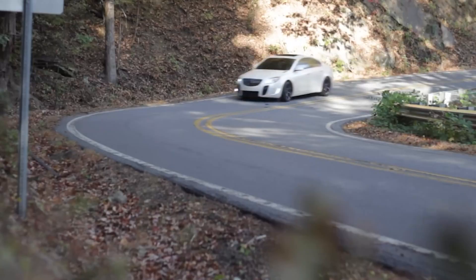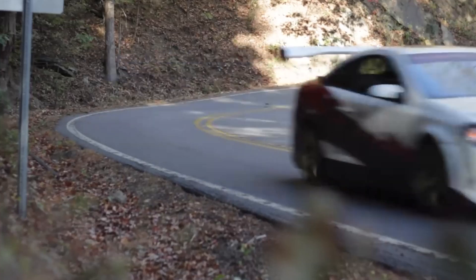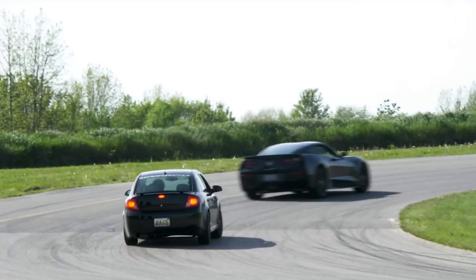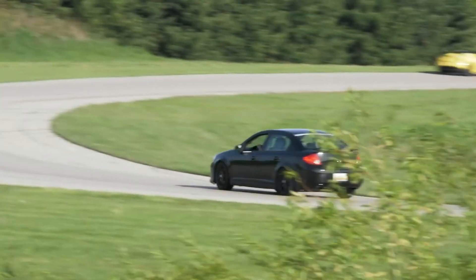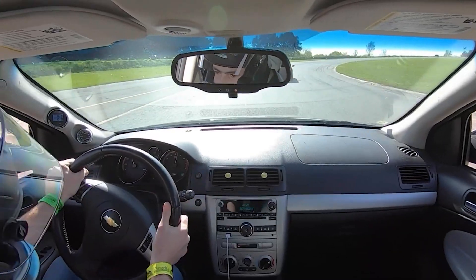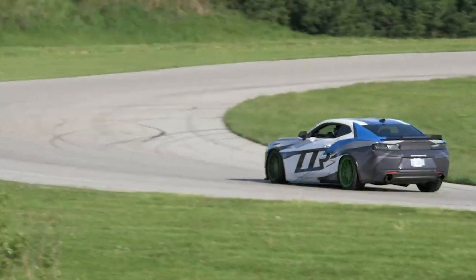The drivetrain of your car has no effect on what sway bars you run. It really is all about how the car feels as you're entering that corner. It doesn't matter if you're rear wheel drive, front wheel drive, or all wheel drive — it does not matter. One point you want to always know: road racing 101 — your tires can only do one thing at a time. They can brake, they can turn, and then they can accelerate. So you should not be doing two at the same time unless you're a very experienced racer with years and thousands of laps.